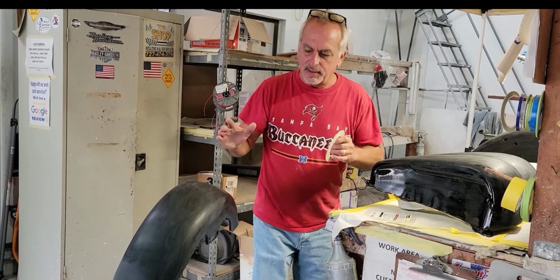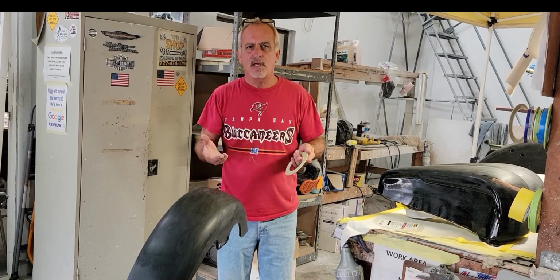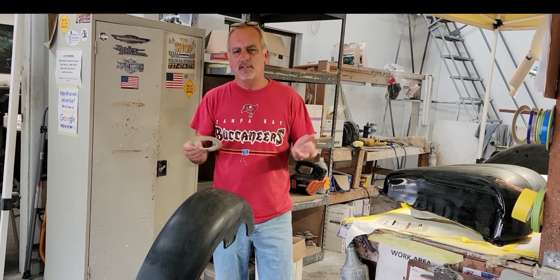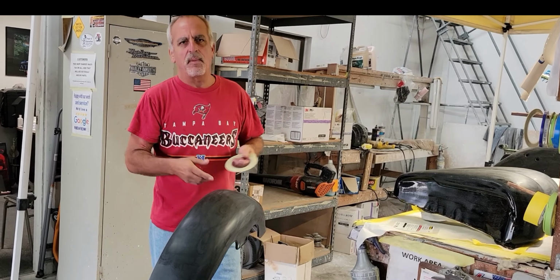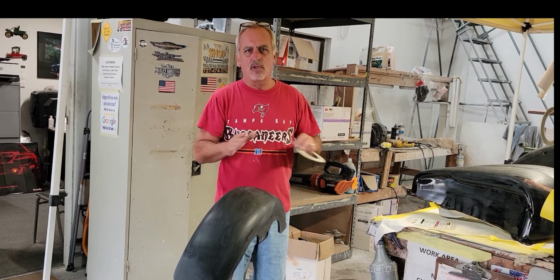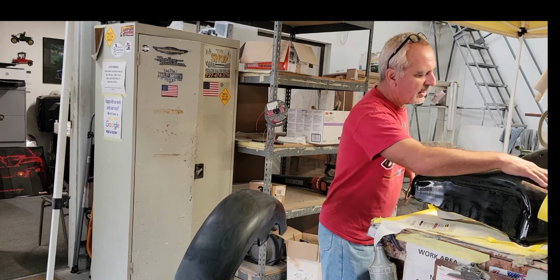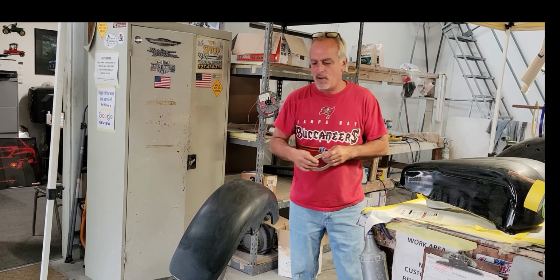So I got these all 600 in wet sand. And what I mean by that, I DA 600 and then I wet sand with half sheets, 1000 grit. Look at one of my previous videos and you'll see how I do that. It solely just shows the process of that. So these are all set. I've wiped them down, I've tacked them off.